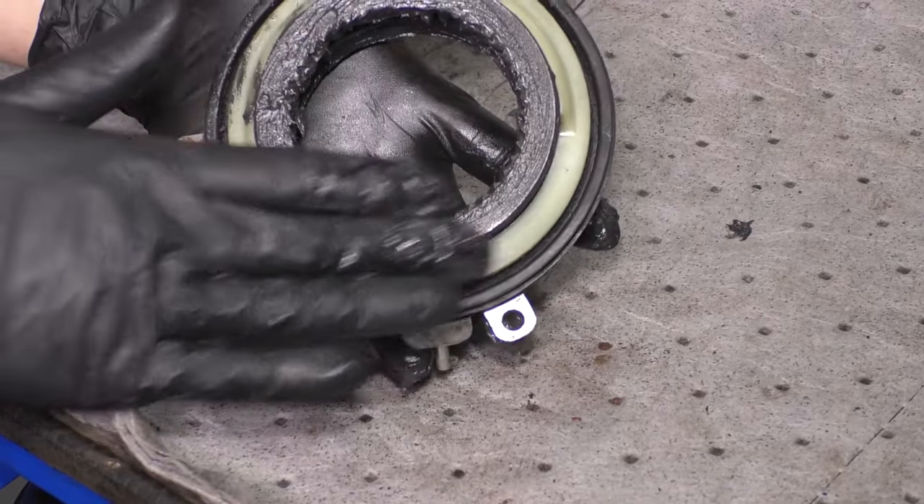With it greased up, let's install it. We're going to get the four-wheel drive vacuum hub over the axle so we can put the two back on the knuckle. Line up the actuator and start in the three bolts that hold it on. Tighten these up — make sure they're nice and snug, but they are small and easy to break, so don't over-tighten. Before we put the axle back through the hub and through the four-wheel drive actuator, I like to apply new grease to the splines even though there's still grease present — it can't hurt, it can only help.